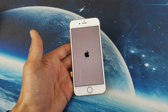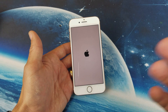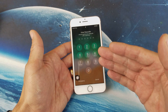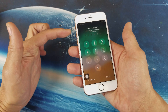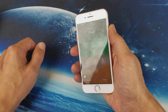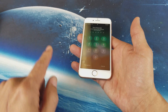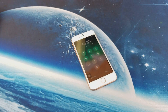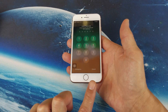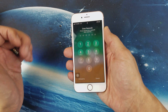Now if you're still having issues — maybe you still have a black screen of death, it's still acting laggy or frozen — another thing you can do is try this step five or six more times: volume up, volume down, press and hold the power button. If you're still having issues, another thing that's worked for me is to grab your iPhone charging cable, plug it in, set it down, and wait 10 minutes. Then come back while the phone is plugged in and do the same force restart again — you may have to try that five or six more times.